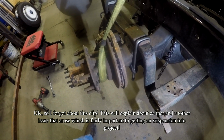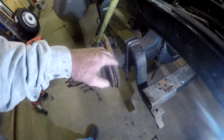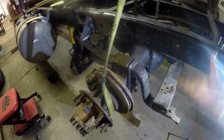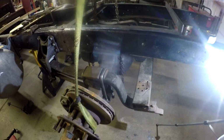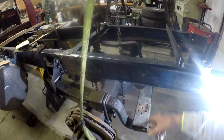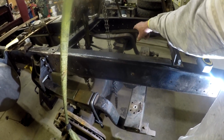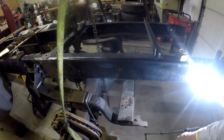Okay, I'm back over here at the haul truck, and this is like the day after I posted part 57 of the haul truck build. So what I'm doing is starting to disassemble the driver's side U-bolts and stuff. Because with those U-bolts cranked up like that, it draws the whole trailing arm suspension of the air suspension down to the axle, and thus pulls that trailing arm down on the passenger side. So what I've got to do is get some free space in between the axle and the trailing arms of the air suspension so that I can get that pin wedge assembly out of there and take it over to the mill and mill that one also.